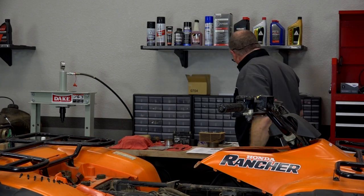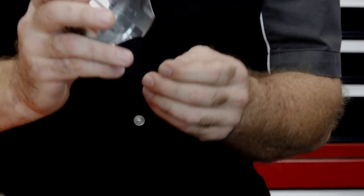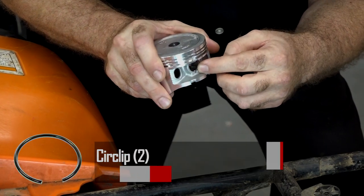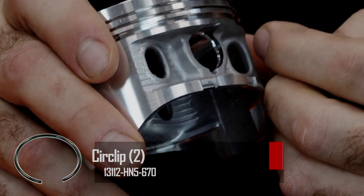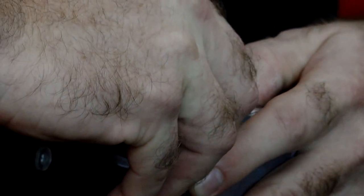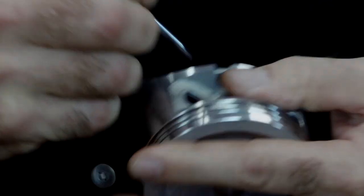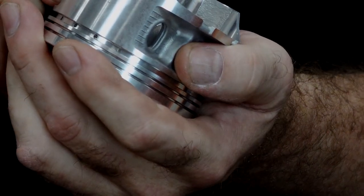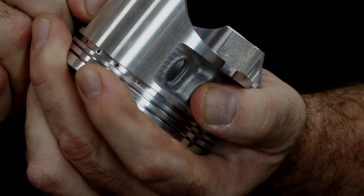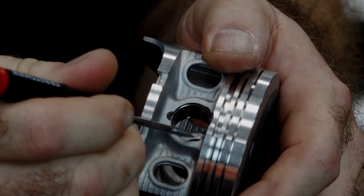Alright, let's start by preparing our piston. First thing I want to do is go ahead and get the circlip that's facing forward in there. The trick here is you do not want the end gap to end up where this little cutout is — you want it to actually be facing up. I usually put the top left in and then just with my fingernails work it around. In that last little section to get it to snap in, you can use a screwdriver to rotate it around and push it in. Carefully — do not want to scratch that inner bore. When it actually goes in you'll hear it snap. There we go. She is seated all the way around and that's what we're after.